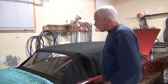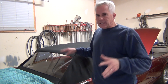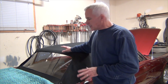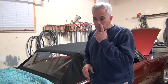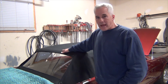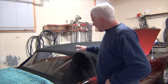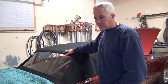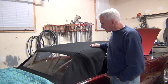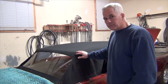One of the biggest things I've learned is I didn't quite understand the concept of how the convertible worked, but really it's three separate components. First is the webbing, and it's really going to set where this back — once you brace your frame and get it where you want it, that webbing is really going to lock in this fourth bow. When you staple it to the second and third bow, it's going to lock those in place too. But other than that, it really is independent of everything else.